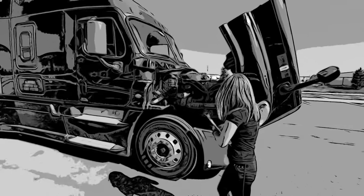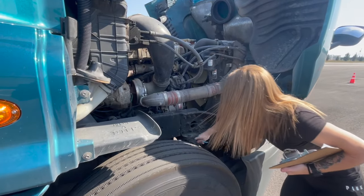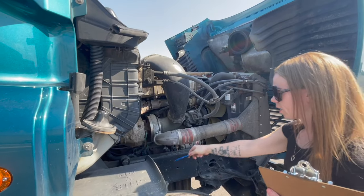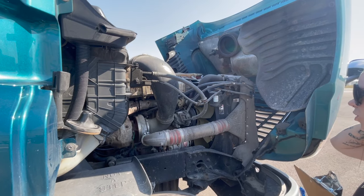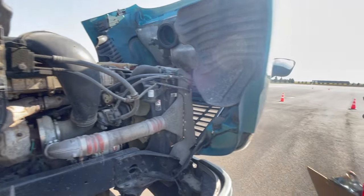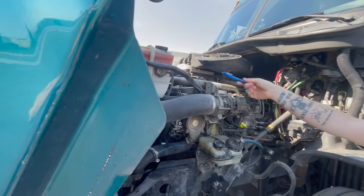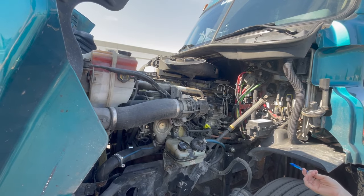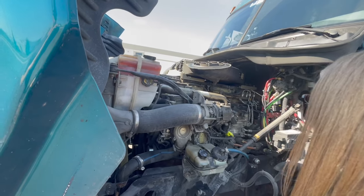Now I'm going to check for fluid and air leaks. There's no dripping fluids on or around the underside of the engine or transmission, and there are no puddles under the truck. General hoses, airlines, and connectors are properly mounted and secured at both ends. There's no abrasions, bulges, or cuts, and they're not leaking. Hose and line couplings and fittings are secured and they're not missing. This applies to both the front and the driver's side.